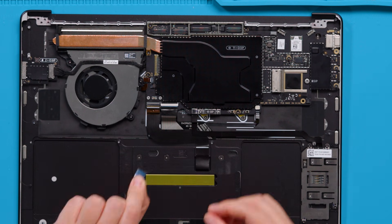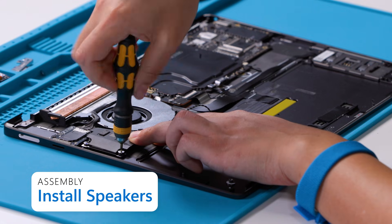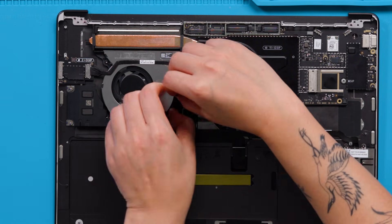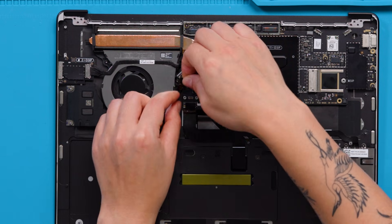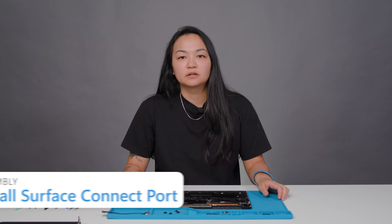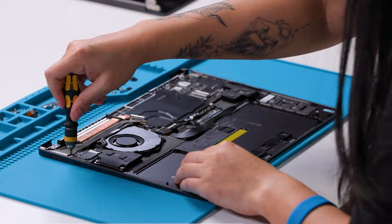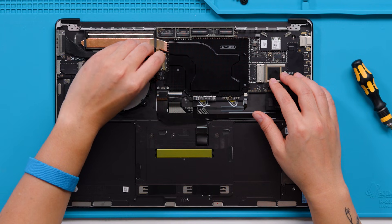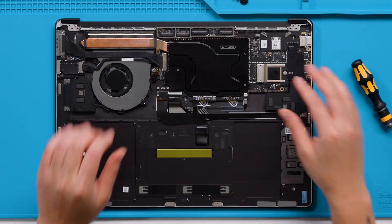Now we need to add new tape to the touchpad connector. Install the speakers. Install two 3IP screws to the left speaker and two 3IP screws to the right speaker. For the left speaker, route the speaker wires around guides on the fan. Install the speaker connectors into the receptacle on the motherboard by pressing vertically until a snap is felt. Install new speaker tape. Install the surface connect port. Install new PSA on the fan. Install the surface connect port with two 3IP screws. Insert the connector of the surface connect cable into the receptacle on the motherboard and close the latch to secure it. There should be a click if the connector is inserted correctly and the latch is fully closed.